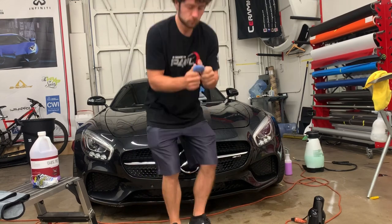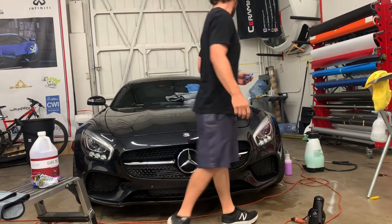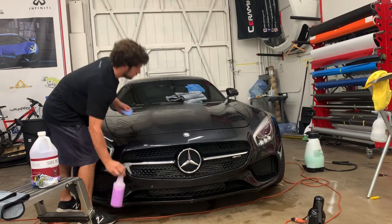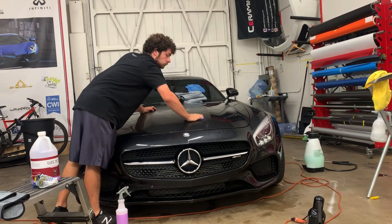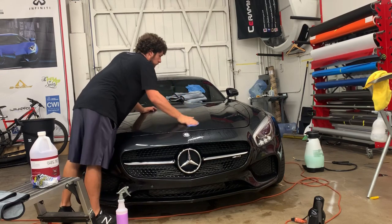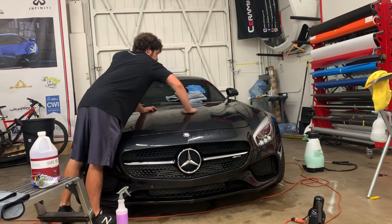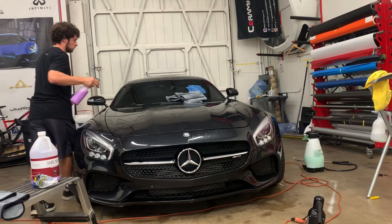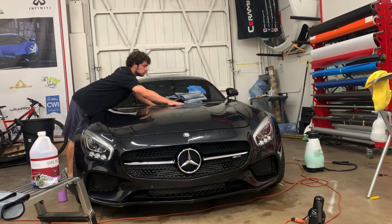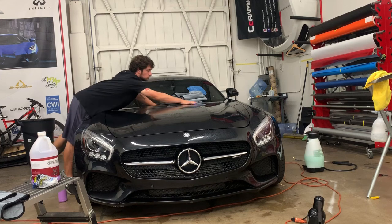So here I go folding the clay. Sometimes what happens is you'll clay the car and then put your hand over it and it'll still feel kind of rough, which means you didn't quite get all of the contaminants out. Clay doesn't remove all contaminants — that's why we buy fallout removers like Iron X. We'll do another video on those at some point. The reason for claying in this case is to make the film adhere better and so there's no debris under the film that could cause an imperfection to show. Normally for most detailers, we're claying a car before we wax it, before we put a coating on it, and definitely before we polish it — because if you try to polish a dirty contaminated car you're basically polishing those contaminants into the paint, which could do more damage or leave buffer trails that are difficult to remove later.